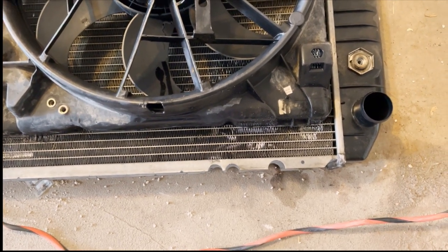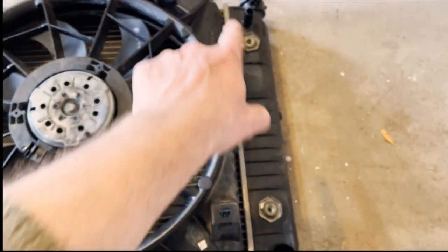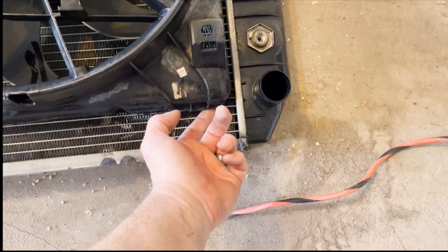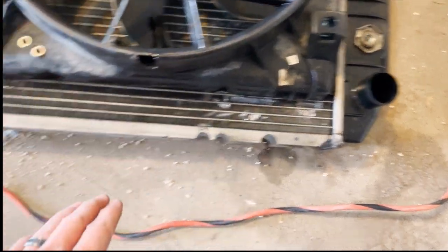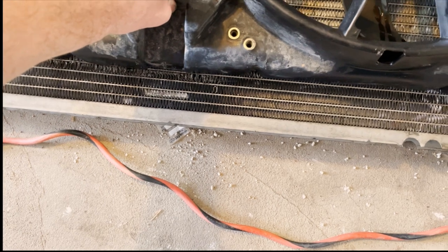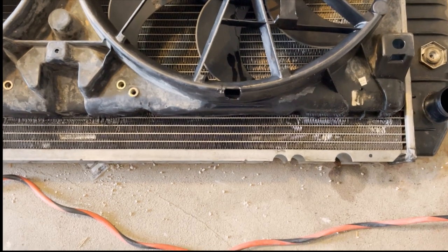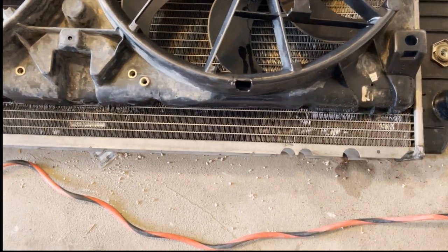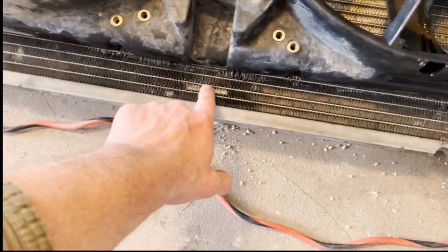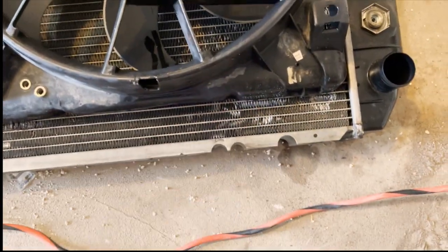That's not very likely. So I think I'm going to put some strip metal right there, bolt it into that flange and that flange, and that way it'll keep something like this from happening again. The offending part has been cut off, but still, when I've got it bracketed through here, it holds it off a little bit - that was my whole idea. I should still be drawing enough air through, and it does cool the truck. I just got to make sure this doesn't happen again - those tabs I cut off were sliding in and out and hitting the fins.